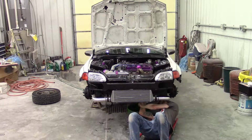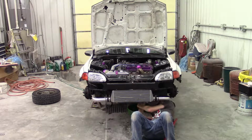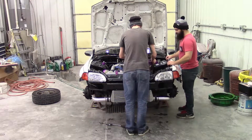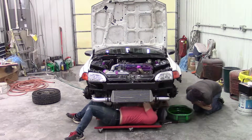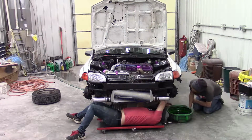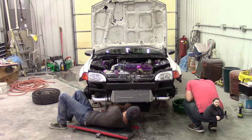We started by draining the oil. It looked good, but still weren't convinced that it wasn't a rod bearing. We went ahead and checked a couple easy things like the rocker arm assembly. They all ended up looking just fine. Checked over the axles. We had one that seemed a bit off, but found nothing there. That led us back to removing the oil pan, finding out for sure if the issue is in the block or elsewhere.